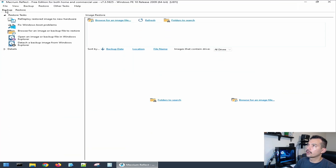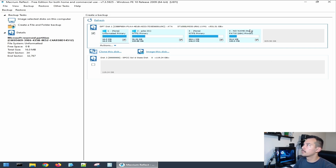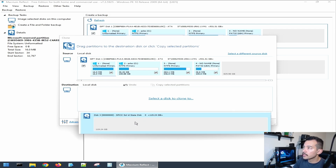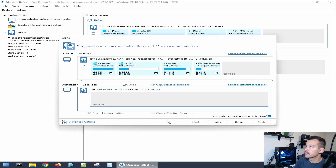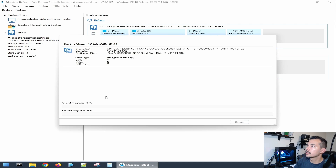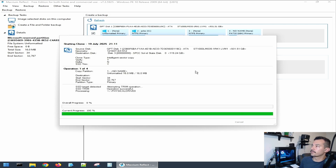In this section, go to Backup — you're going to see the disk image pop up. What you want to do is click Clone This Disk. Another screen is going to open up. Select the disk to clone; you're going to see a disk here that says Solid State Disk, which makes sense. You have all your selections for the environment. Go Next, then Finish, and we're going to start the process. The nice thing about HiRens is that it doesn't change — it's still going to have the same programs, which makes it a lot easier.